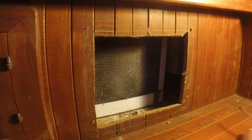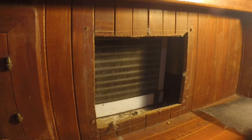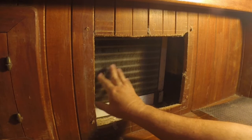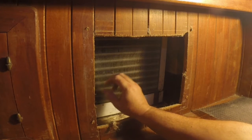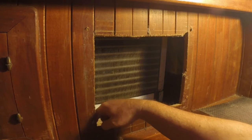So the next step here is to remove this filter. Just like the one in the back, we actually want to just lift this directly up. In this particular case, it's a little easier for me to just unhook it from one side and remove it out that way. Then just like before, I'll get the vacuum and get it good and clean. When you're vacuuming it, these little fins bend very easily, so you want to be really careful not to bend them. You can see down here it looks like it was rubbed a little bit, so I'm going to be cautious we don't make that any worse.